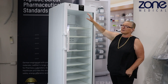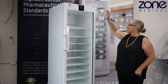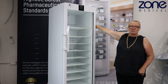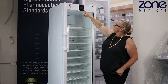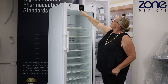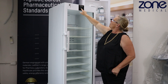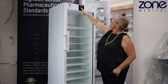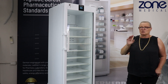Once the min/max check is done, that data is not lost — it is stored at the back of the fridge where you have five years' worth of information. To reset the min/max, touch it, press reset, and then hold the screen for three seconds — one, two, three. You'll see the lights at the top confirm it has been reset. That's all they have to do.